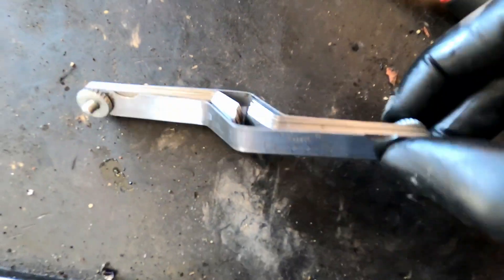That concludes the valve adjustment on the Raptor. It's pretty straightforward, but you definitely are going to want these 45 degree angled feeler gauges. The ones I have are available on Amazon — they're super cheap, I believe when I bought them they were about 10 bucks. I'll leave a link in the description below. You could do it with a set of straight feeler gauges, but it's a lot easier with the 45 degree ones and they're cheap, so definitely worth picking up if you're going to do this repair on your quad. Thanks so much for watching — like the video if you found it helpful, subscribe if you want to see more content like this, and we'll see you in the next video.